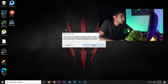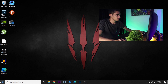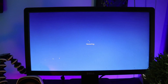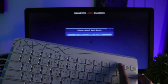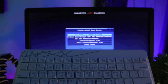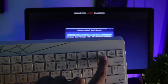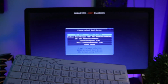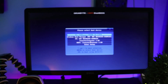Everything is done here. I'm going to close it and restart the PC. When it boots again, you have to press the boot menu key on your keyboard — for me it's F12. For other computers it can be F2, F10, or F12. When my computer was booting I pressed F12, and as you can see there's the boot menu.